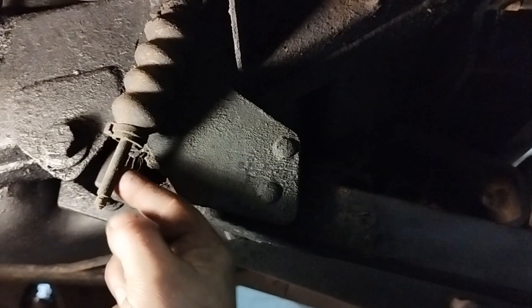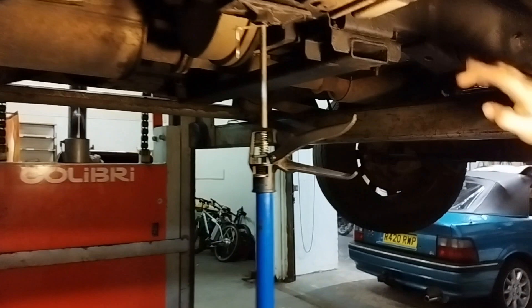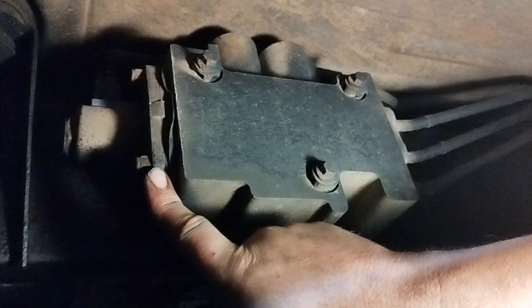Check your exhaust has no holes in it and the back box is alright. Then look along the chassis. You can't really see the boot floor easily from under the car but you can get up there and have a look — they do rot there as well. This is what I was talking about with the rotten step support — you can see it's completely rotted off. That happens on all of them. This one has got a two-inch lift on it, front and back. These ACE pipes have been cut off at the rear because they were leaking — we've blanked that off.